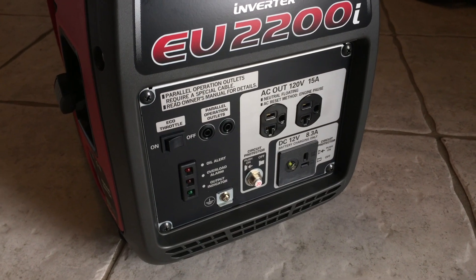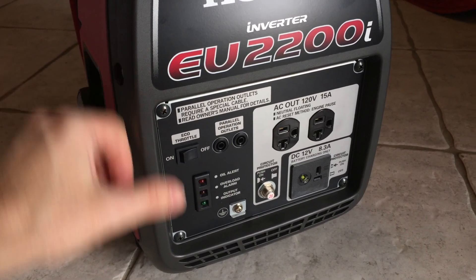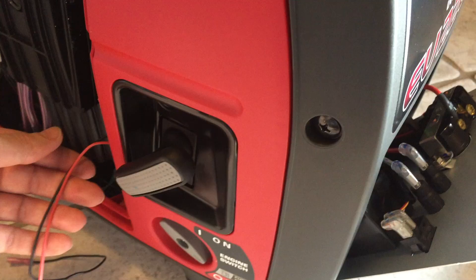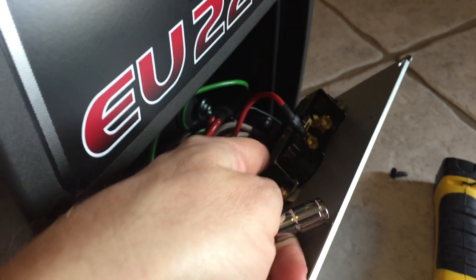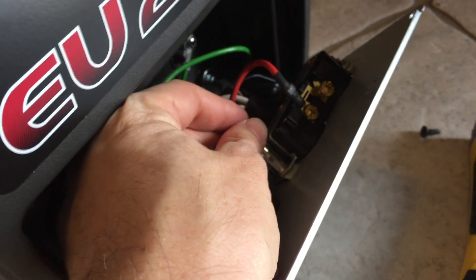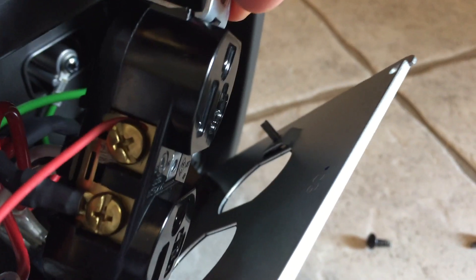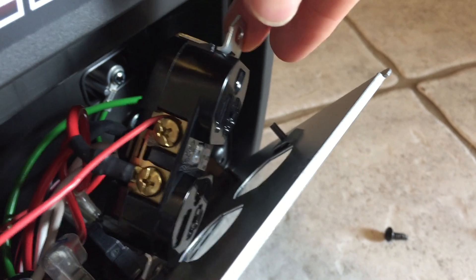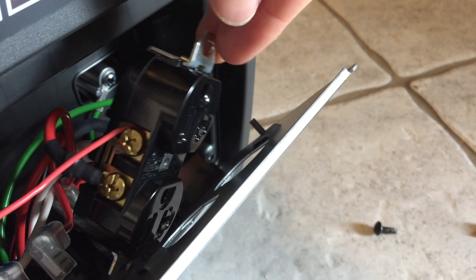To get access to hook up the hour meter, I need to take out these four screws right here. That will allow this to fold forward so I can get access to the screw terminals on the other side. I got the wires fed through with the help of a coat hanger and some string. Now I'm going to take off the AC cover — a seven millimeter socket wrench seems to fit that okay. I went ahead and used the extra screw terminal and screwed one wire to one side of the outlet and the other wire to the other side. It doesn't matter what color you use since this is an AC outlet — just put one on one side and one on the other.